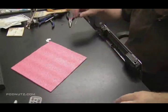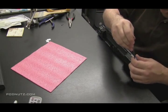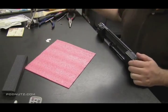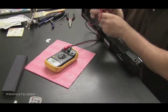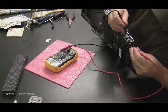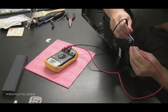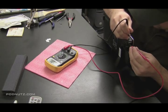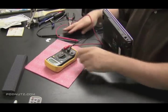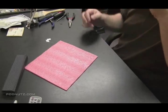Now the hinge cover. I'm going to slow the video up again. Now that I got those screws back in and most of the case screws back in, these remaining screws are holding on the hinge cover plate. We're going to test the work we did with a voltmeter — make sure there's no short circuits. I'm going to set the meter to test for continuity. I'm going to put the positive lead right in the power jack, right on the post in the middle. We're just testing continuity so it doesn't matter what color you use. We're going to attach the other connector to a point on the laptop that's a ground point. If we touch that center post of the power jack and a ground point and we're getting a beep from the voltmeter, we know there's a short circuit. If there's no beep, that means your ground points aren't touching your positive point, and that's what you want — they need to stay separate. I like to test that before I plug the power adapter in because I don't want to fry anything.